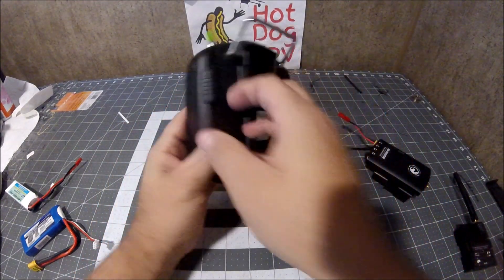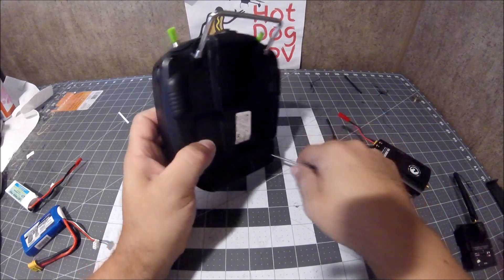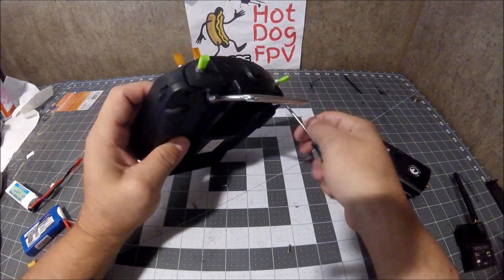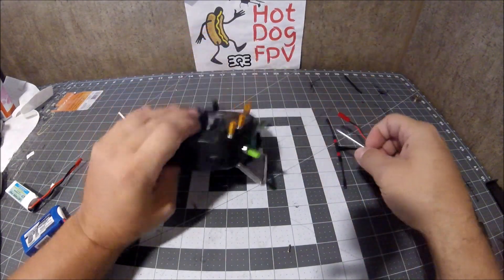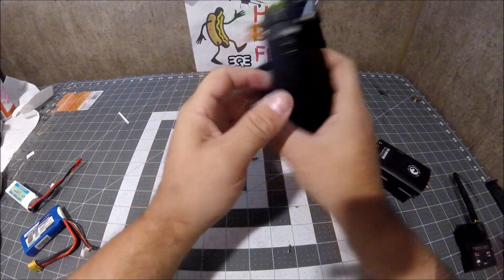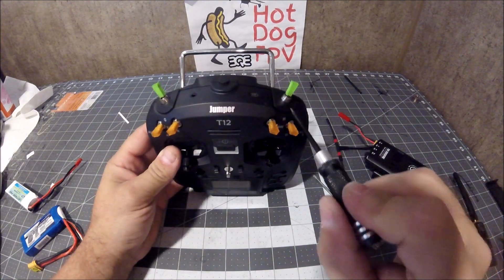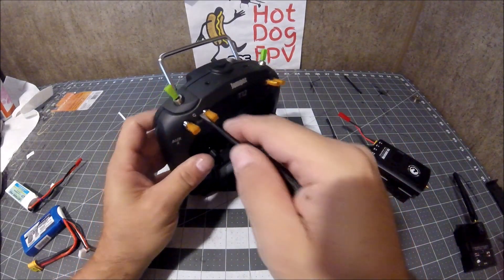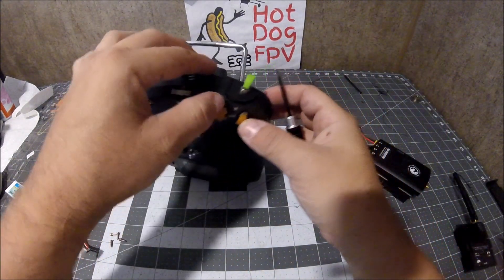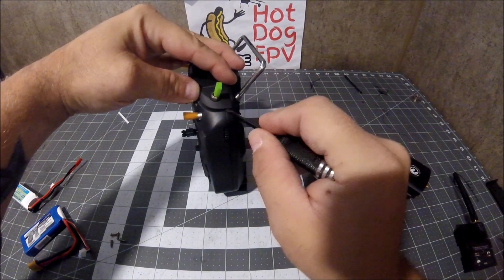To take this apart, you've got six screws — one, two, three, four, five, six. Go ahead and take those out; they'll come out when you pull the back off. You've got to open the bottom, and there's a little trick that took me a while to figure out: you have to pull off these top little sections here. I just took a flat blade screwdriver, come from the front, and they pop loose. Then you've got to kind of lift up and work it from the back as well. This is probably the hardest part about taking it apart.